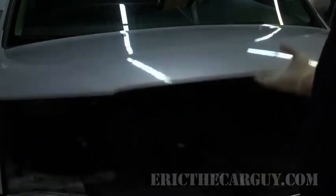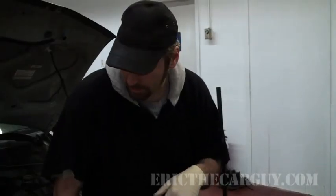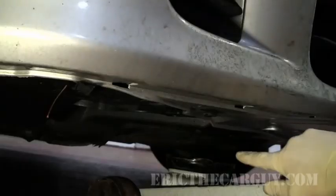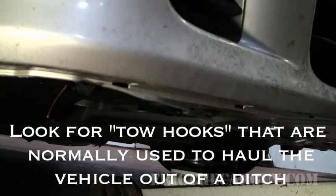Next, come out and open the hood. It's usually a good idea to have the engine warmed up before you do this, especially if it's really cold outside, because the oil might have a hard time coming out of the pan. If you run the engine for a good 10 minutes or so before you start, things under there are going to be kind of toasty, but the oil will run out a lot faster. I just drove this, so I'm not going to run it at all. Next, we're going to jack the car up. I'm going to use this floor jack — there are a couple of little hooks underneath the front of the car that you can jack the car up from to get under the lift points on the side. On this one, the hooks are kind of hidden up underneath this shield, but you can jack the front of the car up by these.